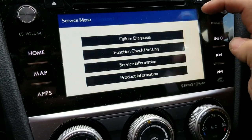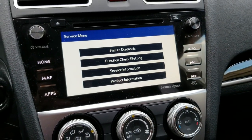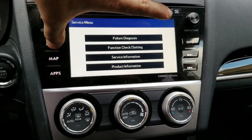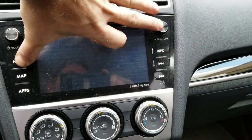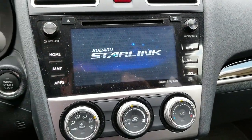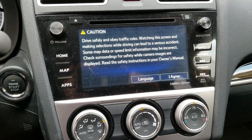I just wanted to show you how to get into that service menu. In order to get out of the service menu, you want to hit the home button, hold it, and hit the power button two times — one, two. And what's going to happen: it's going to reload the radio again.